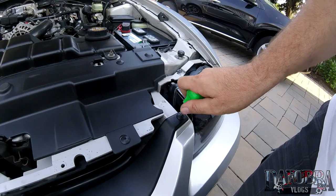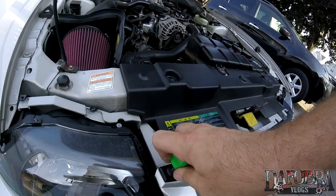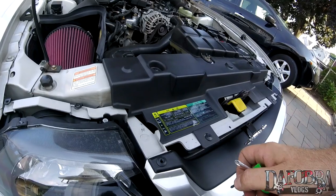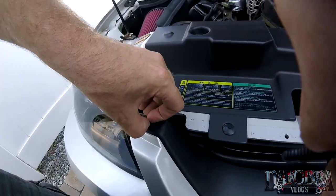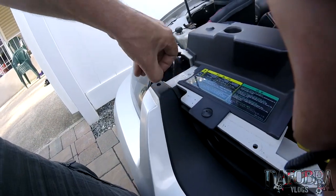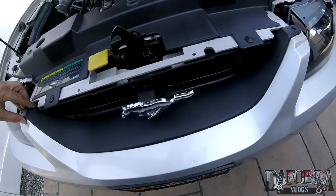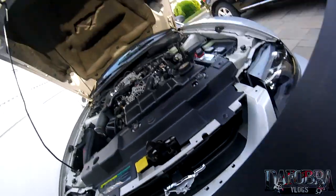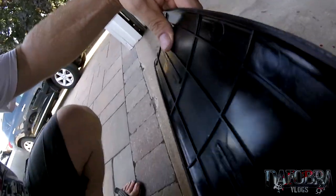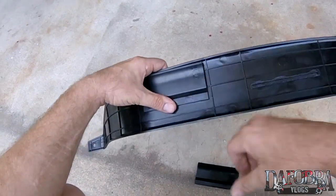It's been a few months since I made this video and I think it's time for an update. One day I was outside washing my car and I noticed that the Mach 1 grille was moving around a little more than normal. So I removed the two top plastic retainers and found that the bottom clips, which sandwich the front bumper cover, had separated from the main grille. I've come to learn that these are simply glued on, so at some point the glue just let go. I gave American Muscle a call and they told me I was outside the warranty period, and that I could try some epoxy — but the fact remains that their design is a poor one.